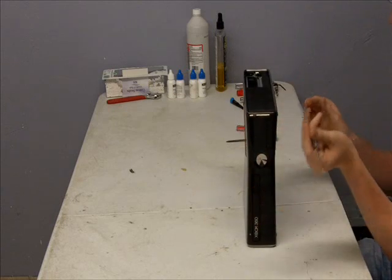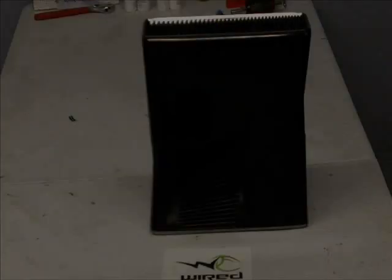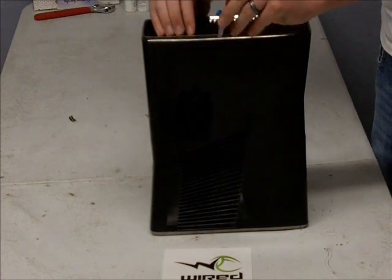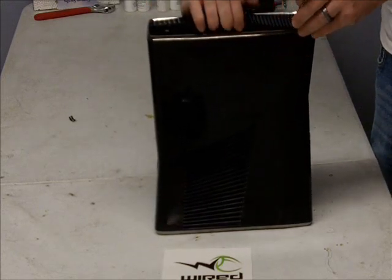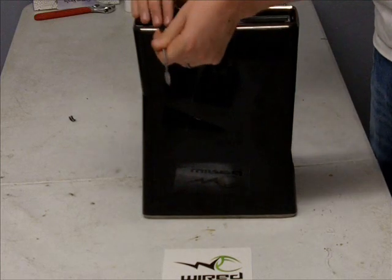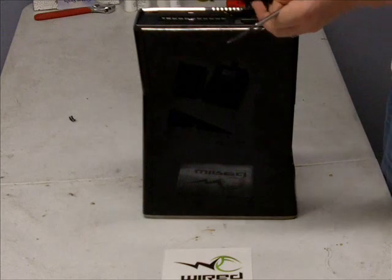To do this, you'll need a flat spatula like this, and you will have to get down into these grooves. Get the flat tool, stick it in here, pop up these sides, hold on to it while you pop it up, and the top comes off. Same thing on the bottom — it simply comes off. So two pieces, just a bunch of clips; get your tool in there and it pops right up.